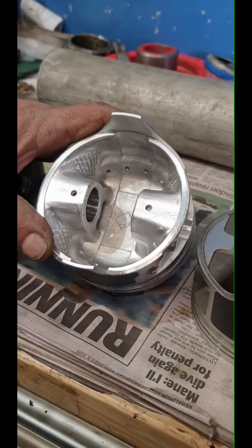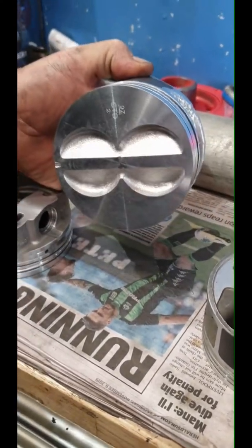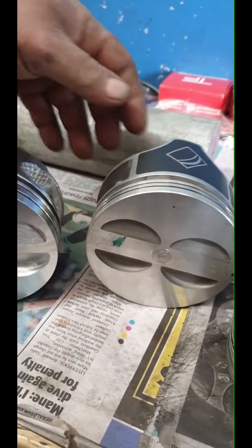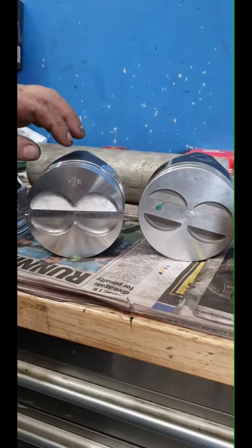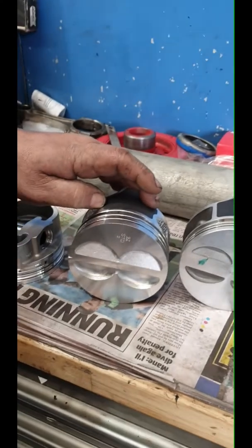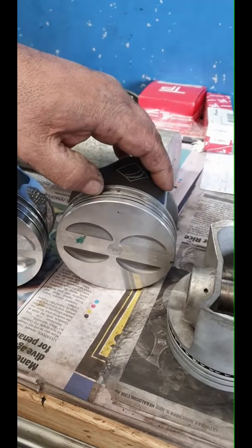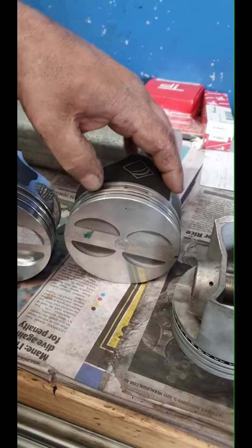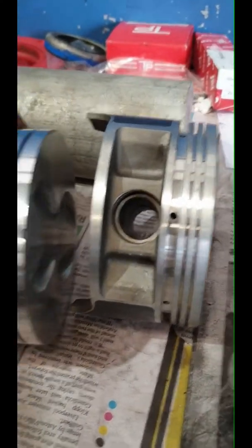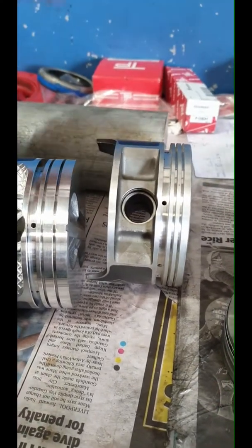This one is a hypertech piston - a standard replacement for a 383 stroker. Believe it or not, that is a 383 stroker as well, exactly the same. This is what we use in the strokers that you drive around every day - go to work and back, go for a bit of a thrash. This was designed to be more of a forged style piston in the market, but there's a lot of failure in them. See where the rings are? They're really, really close to each other compared to the other one, so a lot of heat was getting in there - it wasn't really a good idea.